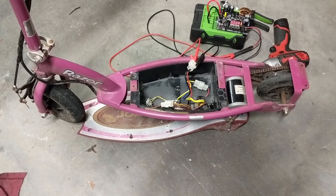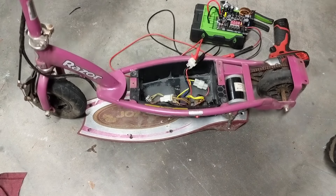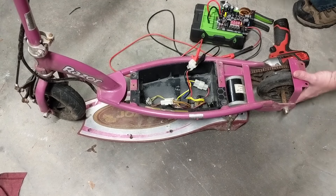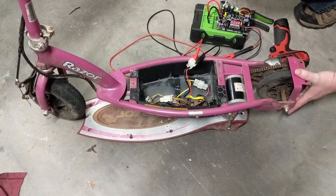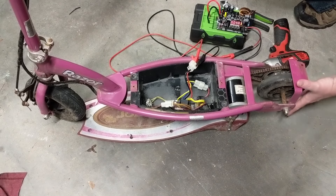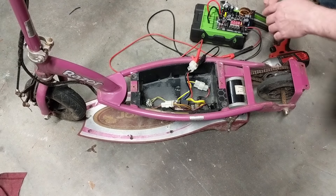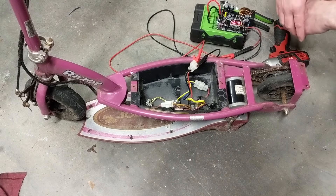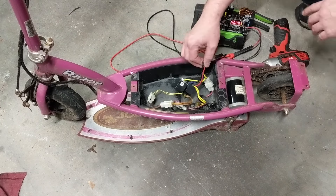Just hitting the button: on this E100 scooter, at least — I don't know about all the Razor scooters but I know the E100 — just clicking the button doesn't start the motor. I thought it might start slow and then get fast, but it's like a kick-start. You've got to give it a push, and it does. That's how the board is supposed to operate — if it gets that feedback from the motor, it will actually pick up and start the motor assist. That's a win; we got that fixed.